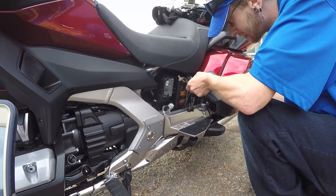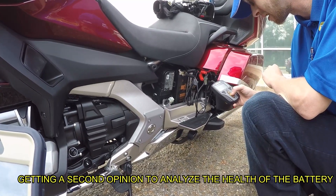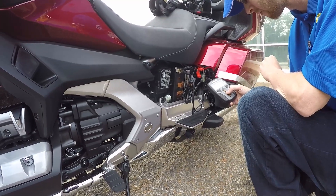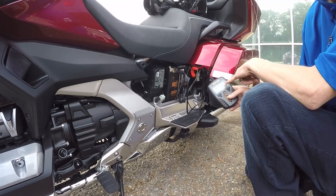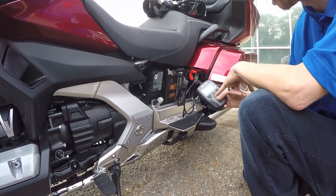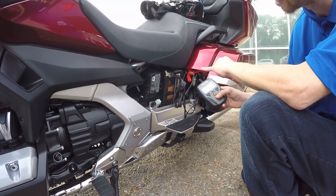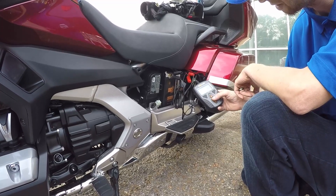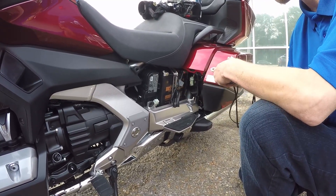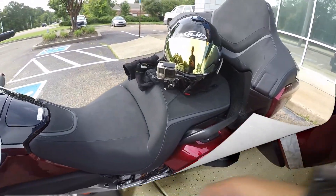250 cranking amps — yes sir. Honda likes that. This will be the Yuasa GYZ20L. It's still showing okay — 13.25 volts, still showing great, still really good power. I started it at the 250 and it's going to read the max and show what it can start at, which is 46. So you're still copacetic — you're good. I'm glad we could actually get that figured out a little better for you. You're still good. I appreciate it. Thank you.